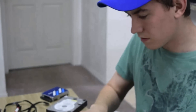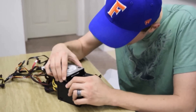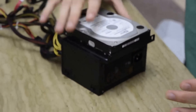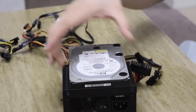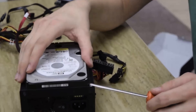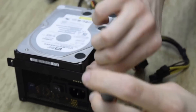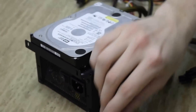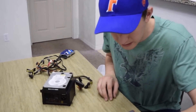Now I'm just going to attach a 3.5-inch drive to the top casing to give you an idea of how that works. Silverstone's manual suggests you install this prior to putting the power supply bracket back because once you install it you lose the ability to get to the screws on this side. Having labels for your screws would be really advantageous here, but unfortunately I didn't think that far ahead.